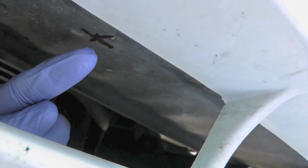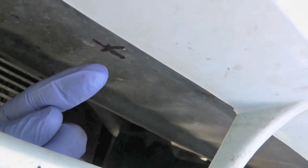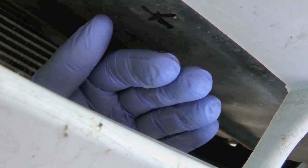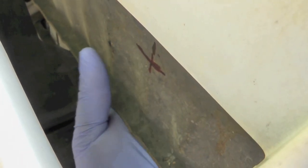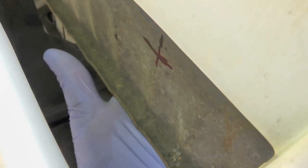You can see I marked the center point — it's an inch and a half back from the bumper cover. That should mount the light. I measured it with the mounting bracket so it'll be pretty much flush with the bumper cover. Same thing on this side. I'm going to drill a pilot hole right in the middle there, and then come back and drill the correct size hole. You can put your hand up and feel behind there — there's clearance on both sides, so these are ideal mounting points.